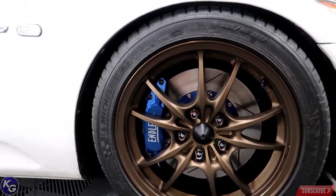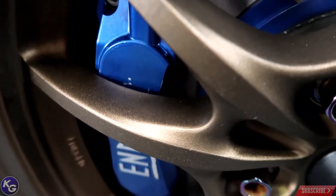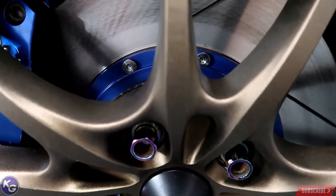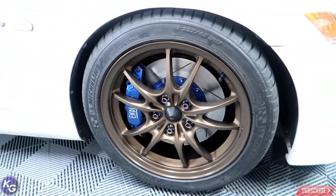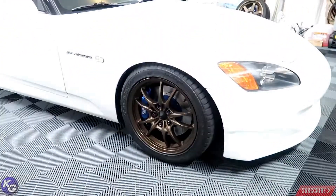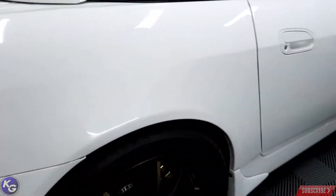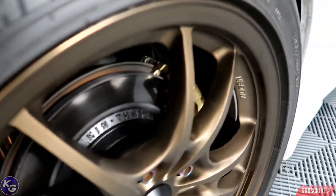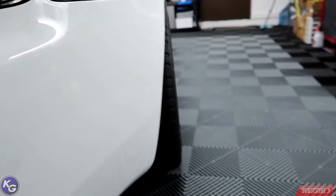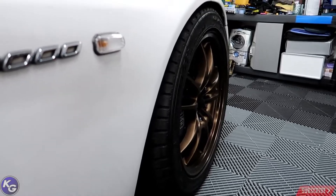Here they are with the Mugen wheels — looking very, very nice in there. Clearance is pretty close. I'm running a 15 millimeter spacer on top of another 5 millimeter spacer, so about 20mm total — it's really close. If you're going to run this setup, I recommend just going with a 20 millimeter spacer and calling it a day. The rear is running a 20 millimeter spacer as well, which is not necessary for stock brakes but just to flush things out a bit.